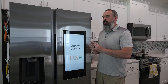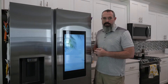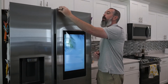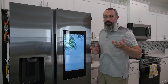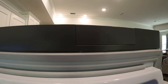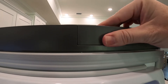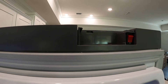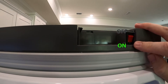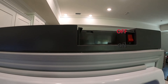But what if you can't navigate very well or can't get through those settings? There is a manual switch. The manual switch is right here on the top of the door — it's easier if we just open it up. When you open up the refrigerator door, you'll see this access panel. Simply put a little pressure in and then pull up. That will reveal this red toggle switch. Currently it's in the down or on position. All you need to do is flip it up and that will cut power to the hub.